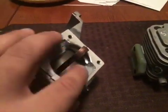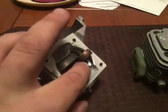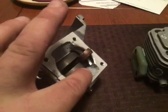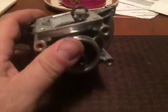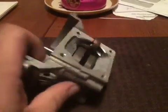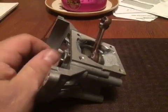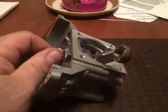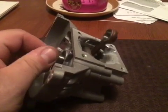I know some guys go right up to the height of the crank and that works great, but I don't do it like that on my drag mods. I'm a guy that thinks if you're going to really get some crazy RPM, you need a certain amount of crankcase volume, you know, whether you go by stroke or not.